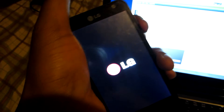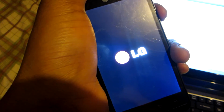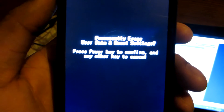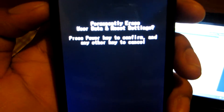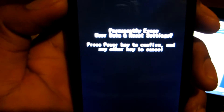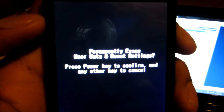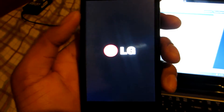I'm going to power up the phone. What you're going to do is hold both volume key buttons. We'll see if it goes to recovery mode — there it is, it did it. Now it's going to say permanently erase user data and reset settings. This is not true — it's just something that's part of the program, so you don't have to panic. Press the power button three times: it's going to say are you sure you want to erase, click it again, it's going to say confirm, press the power button again.